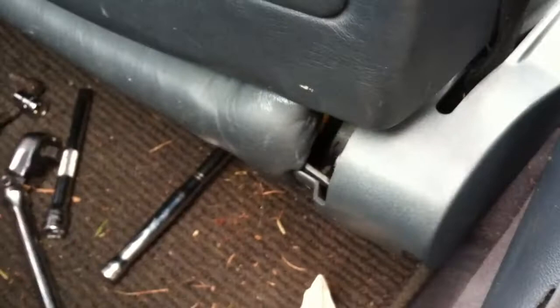Okay, so I got the two bolts out. I moved the seat all the way back. Now let's see what's up front. Up front, if you notice, there are two hooks — there's one right here and one right here. What you have to do is pull the seat back and these pop right off the hook. I'm going to show you just one side — pops right off like that. Do the same thing for the other side.